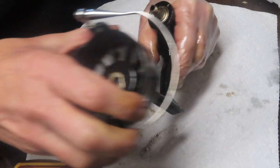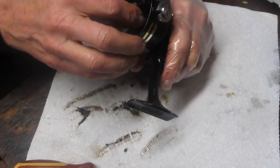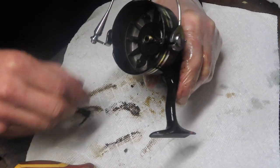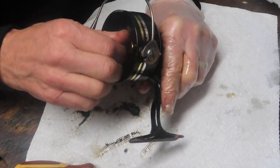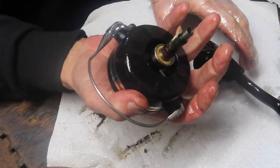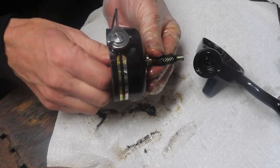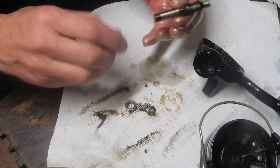And if you have trouble with it, and I'm having a little bit of trouble here, you want to take the rotor, put the rotor back on, and use the rotor as a handle. It's a lot easier than trying to grab a small surface. Grab the big surface, and it'll just pull right out. So that wasn't planned that way. That was lucky, but that's the way to get additional leverage if you need that additional leverage.